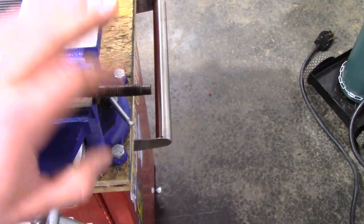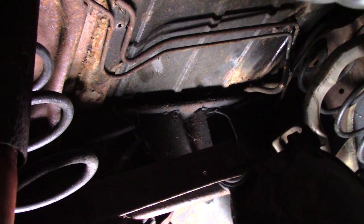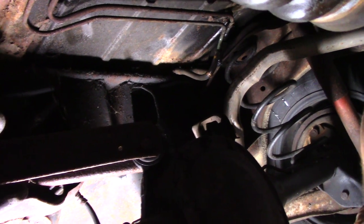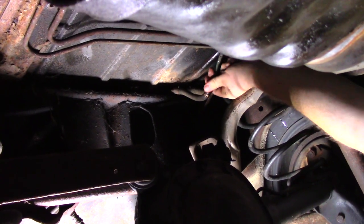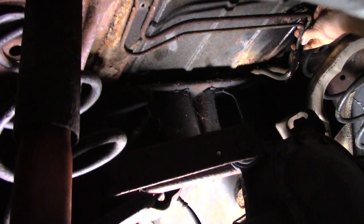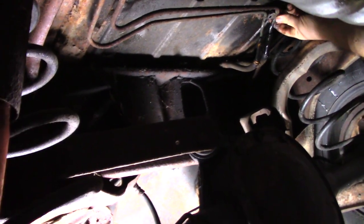I've pulled them down with WD-40 just to help when we go do the install and put it back together. What he's doing - there's a flex hose that goes from the hard line. You can see the hard line and there's a flex hose right over there by that spring. Those hoses are a little bit dry rot, so he's just soaking them with some WD-40 so we can get them to come off a little bit easier. We've got to get those off first because it's a hard line all the way to the tank.